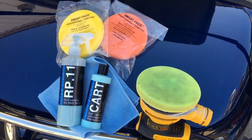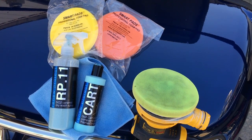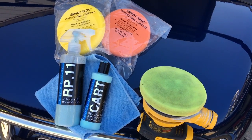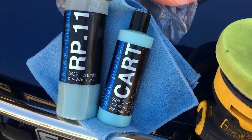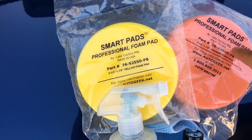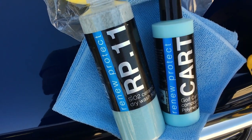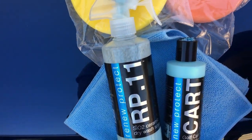A little further explanation on the buffing aspect of this detail: with carts, just as with acrylic windscreens or gel coat for boats or RVs, these painted or solid color surfaces you can buff quite intensely. That's why our cart product has a micro abrasive which starts out quite strong. I always tend to go with a medium cut pad and a polish pad — most often in this case that was quite adequate. A one-time buffing over quite slowly with the cart product, then we sprayed it down with RP11 for extra shine and extra protection, and gave it a wipe with microfiber towels.